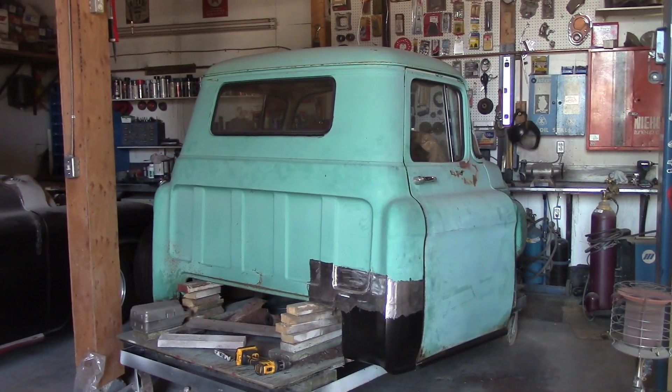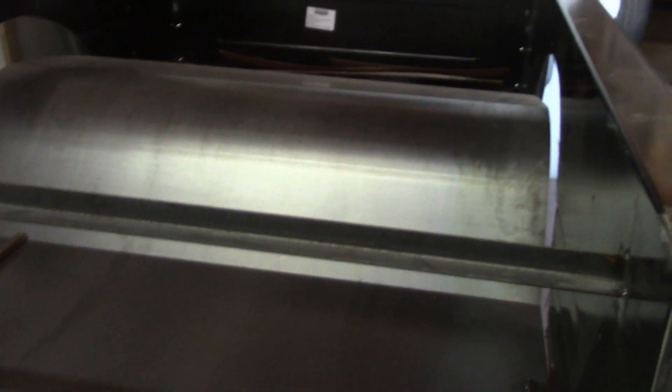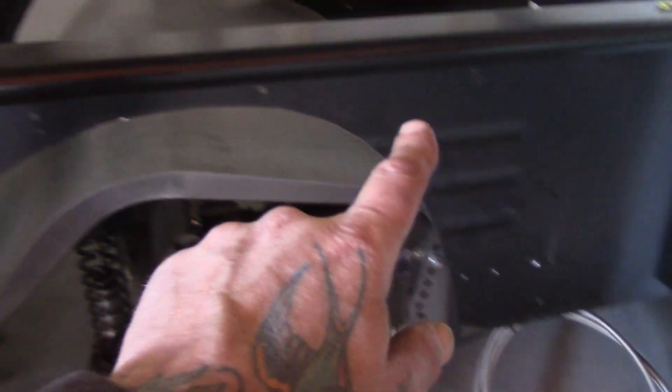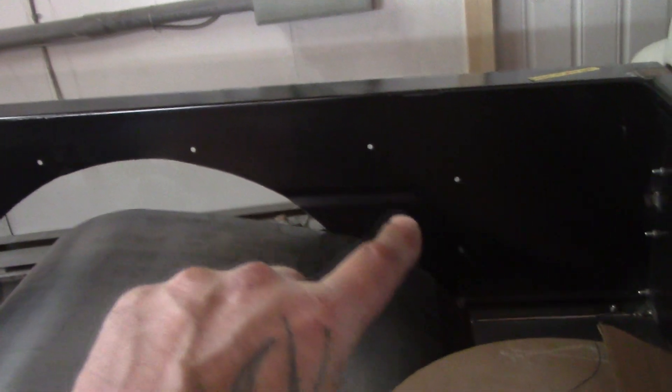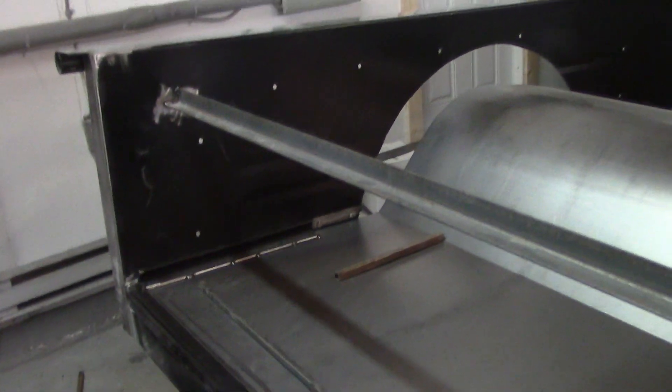In the corner we've got the little '56 Chevy. The owner wanted the floor made up — one big piece of cold-rolled steel — and we fit it in there, fits really good. Next we've got our templates cut out for the wheel tubs. Once we cut that out we can start to plate it. Here's the cardboard template — this here is going to come out a lot further, then we'll cut the floor up and start doing our tubs. The box is braced up and squared, we've welded up the stake pocket holes, and we're customizing how the tailgate goes — it's actually going to sit flush inside.